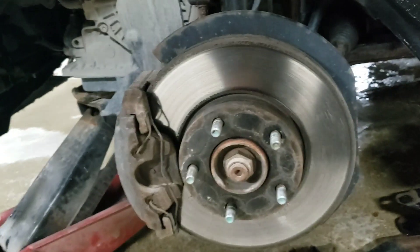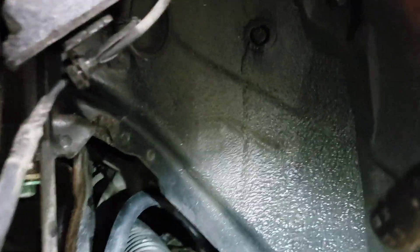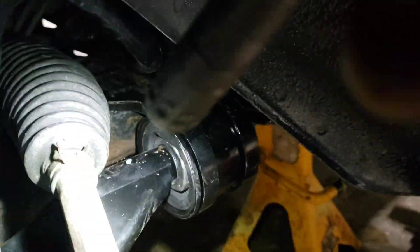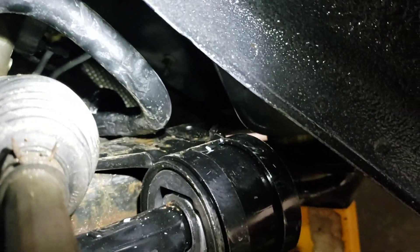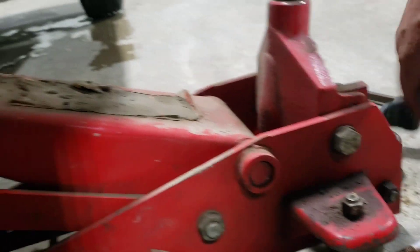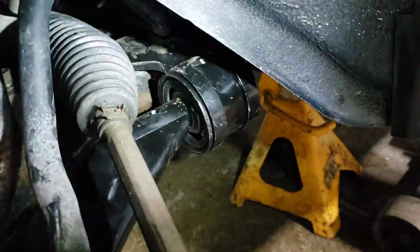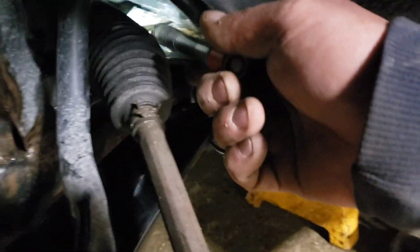Since it's very low I'll probably just jack up the underside of the control arm so it's sitting straight when I torque that. Slide that back in. That's the sway bar bushing — I ended up pushing it over and the whole bracket comes off. They're not captive nuts so I lost them in there, so I got a magnet. Now that that's on, I'll push that bushing back and get the nuts.